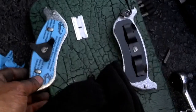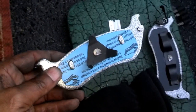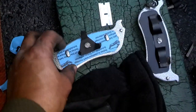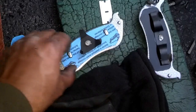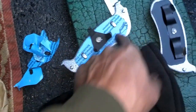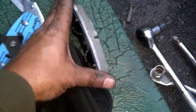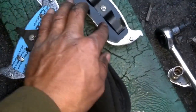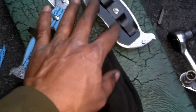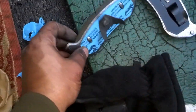Okay, when I got the new pads, they had some kind of blue coating on them, and it said remove that, so I had to cut around with a razor blade to get that off. So I peeled that off. I put grease around where the caliper piston would touch this. I put grease on the upper tracks and on the back side of this, but this has kind of a tacky feel to it, so I may not have needed to do that.